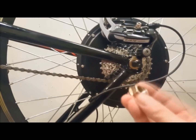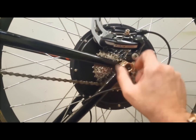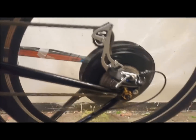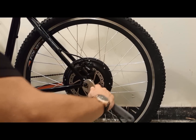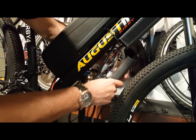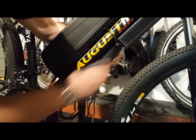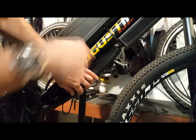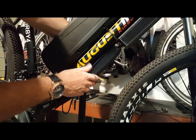To install the rear hub motor, place your bike upside down on the ground and remove your rear wheel. Your rear hub motor fits the standard 135mm dropout. Install the wheel with the washers in the correct order — see our video on installing a rear hub motor. Spin the wheel to make sure the gearing works properly. Next, find a good place on your bike to attach the controller, making sure the wires are pointed toward the bottom of the bike. You can safely attach the controller to your frame with two strong zip ties. Make the appropriate connections with your motor — see our video on controller installation.